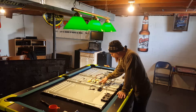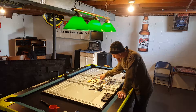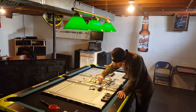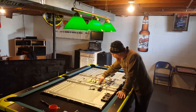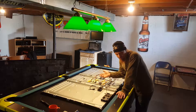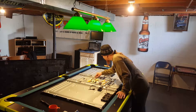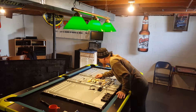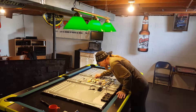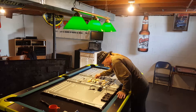So we're going to look over the board for these black round things — or brown. They can come in various colors but they're going to be round, and we're going to look at the ends of them. Some of them might be bulging and that indicates that we have a bad board. Sometimes you just can't tell. What we have here actually appears to be a healthy board — all of the capacitors are good.